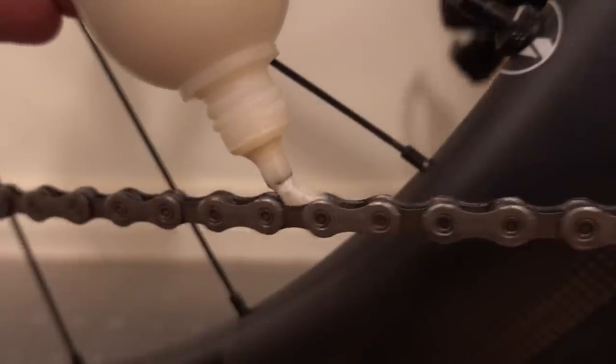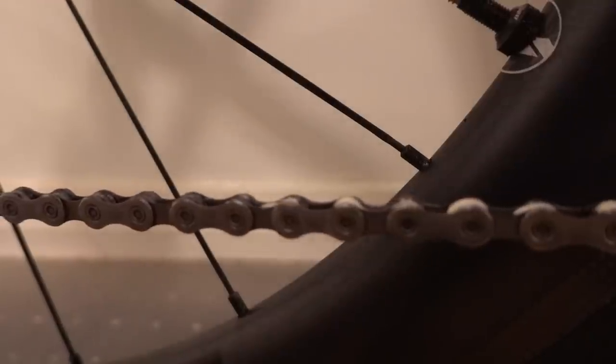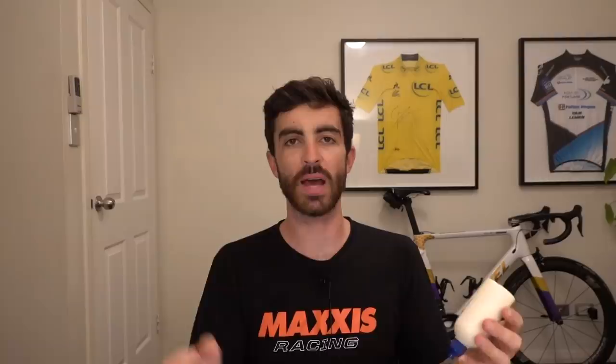Then you're good to go. Simply install the chain on your bike as you normally would, then apply the Squirt Lube to the chain. I drip it to the inside of the rollers — Squirt Lube upside down, squeeze it out so you're getting a drop on each roller, and just pedal the cranks backwards a few times. I might go around the chain twice to get it to soak in. Once it's dripped on, keep turning the pedals to help the wax-based lube get into the inside of the rollers. Keep doing that a few times and you're good to go.